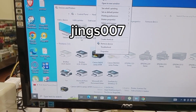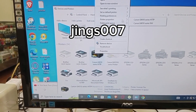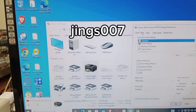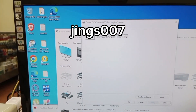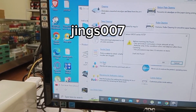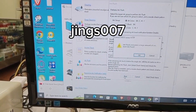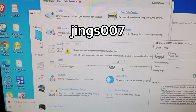The driver is now installed on this computer. All you have to do is right-click the printer icon, go to Printing Preferences, then go to the model of your printer, and after that go to Maintenance and click Maintenance Preferences. As you can see, we are now on the maintenance settings. Just click Ink Flush, then after you click Ink Flush, click All, then click Start.